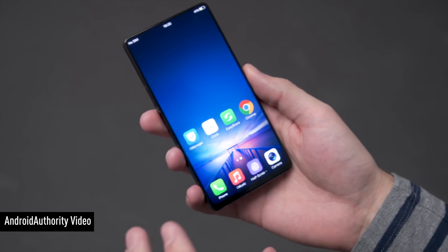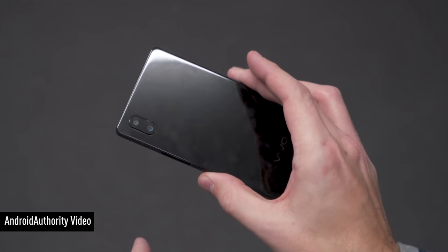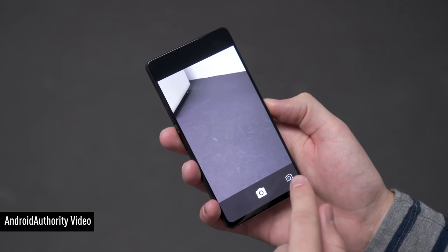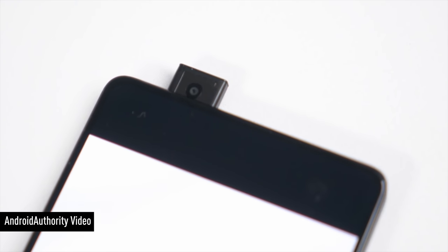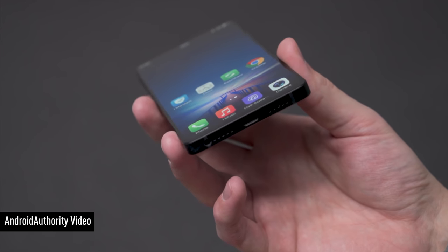The light and proximity sensors are still in the tiny bottom bezel and at the top, so they still work. The earpiece is the piezoelectric speaker, so it's vibrating the glass and you can hear it when you put your ear up to it. The fingerprint reader is a massive optical sensor in the middle of the display underneath about a third of the glass. And the front-facing camera is actually on a motor that pops up in a little housing from the top of the phone when you turn it on. That is the length they went to to give us this bezel-less phone. They used a flexible OLED display and curved all the drivers and edges underneath, leaving you with this beautiful six-inch bezel-less screen. But it's a concept phone, and it's a concept phone for a reason.